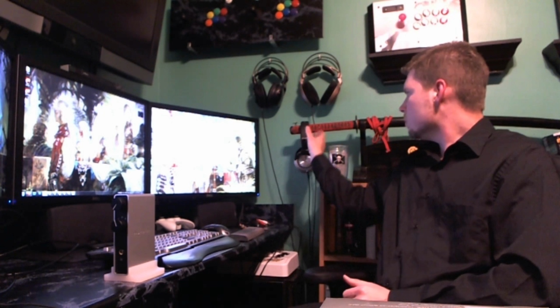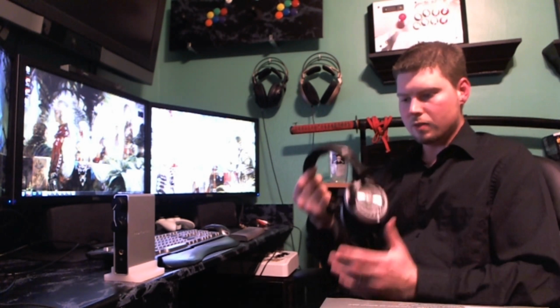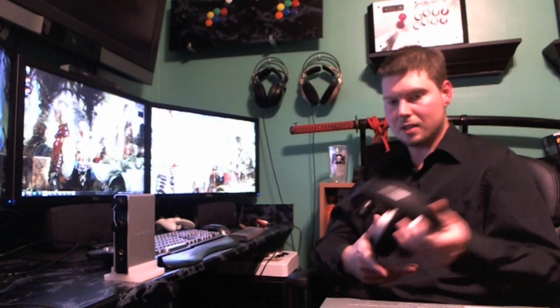So first, power. When you move up the ranks of headphones, which you might be tempted to do once you start getting some nicer equipment, higher quality headphones oftentimes have a higher impedance. And what happens if you were to take some 600 ohm headphones and try to plug them into your iPod, it would be a disaster. It would sound horrible and you'd have very low volume, and that's because the amplifier of that device is not designed to be able to run high impedance headphones.